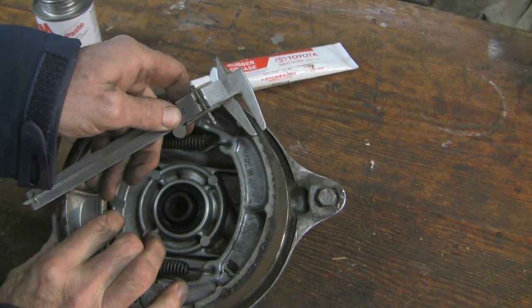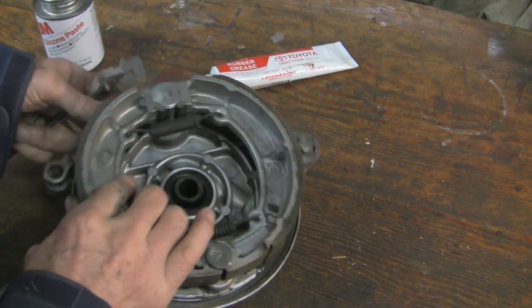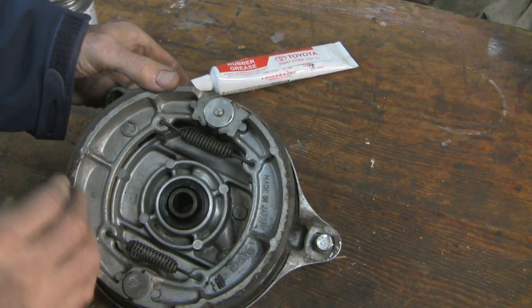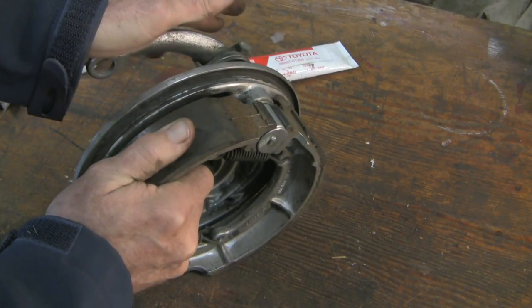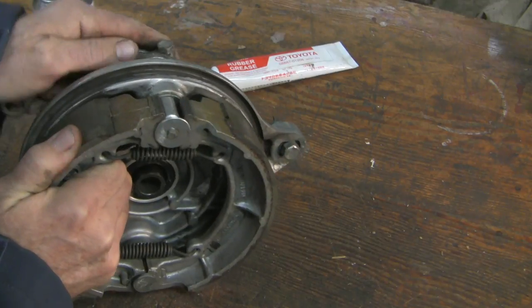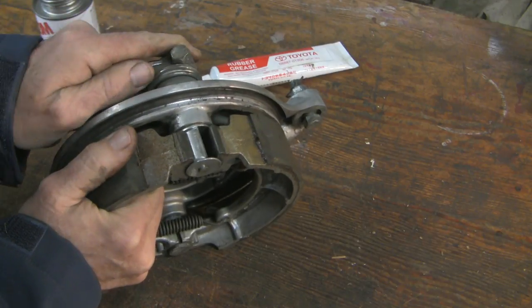Now let's look at the brake shoes. I'm measuring all along here and the smallest thickness I get is about 4.6 millimeters, which is well above the minimum threshold of 2.6 millimeters, so these shoes are good. If you do end up having to replace them, you replace the entire assembly - this part right here just pries off and you replace it. I'm not seeing any evidence of rust or degeneration. When you put your foot on the brake pedal, it's purely mechanical - it pulls on this lever, and look: this bar twists sideways and pushes the shoes against the inner aspect of the drum on both sides. Pretty simple - for a bike, this is all you really need.